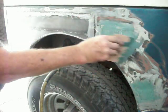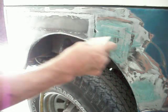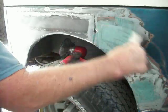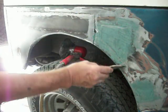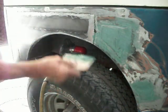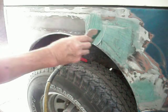I want to force it into wherever the welds are. Now you don't want to work body putty too much — a lot of body guys will tell you to put it on with the fastest, straightest sweep you can. But what I'm after with this fiberglass is just to cover my welds. Now if I had a better squeegee here I'd get a smoother mark, but I'm not worried about that. What you're after is you want to clean up around the edges — don't leave any extra there, get a little weld showing. Wherever you see the edges of the welds you want to make sure you've got fiberglass stuff that's waterproof in there.